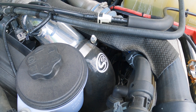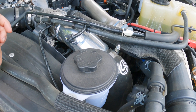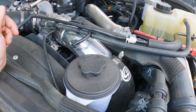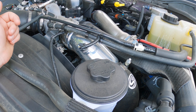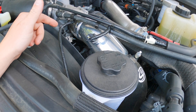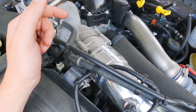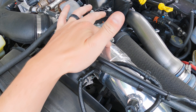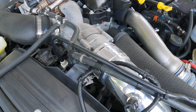It's not too expensive of an install. It's certainly a nice pipe. I actually had a problem with it because I installed it incorrectly and pinched my O-ring, so it resulted in a boost leak because it was really hard to get on this connection up here. So if you are going to install this, just make sure that you're getting a little bit of lubricant on the O-ring so this pipe will slide back onto your intake nice and easy.